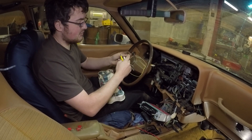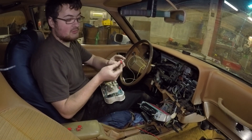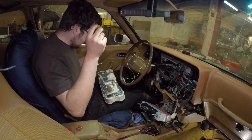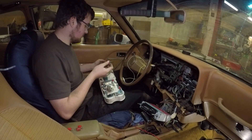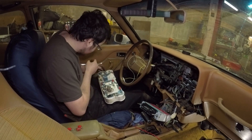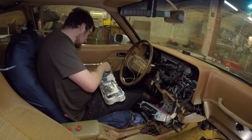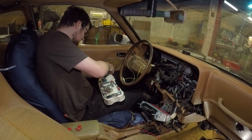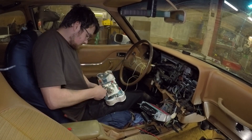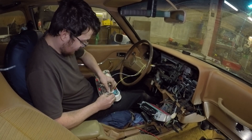What I'm doing is testing from the contacts on the lamp holder to ensure the contacts from lamp to holder are good. If the contacts on the holder are fine, that only leaves the PCB contacts as a potential source of failure — that kind of makes sense. I don't like the look of this one over here, it's quite heavily worn. We'll get them all popped back in. One, two, three, four — all working.